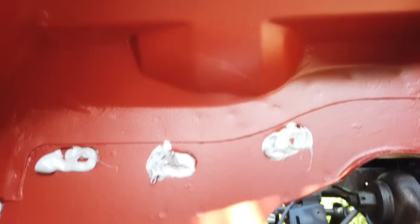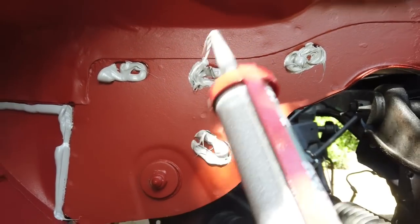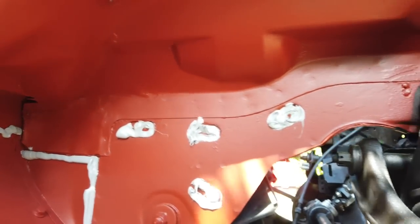Yeah, let's do these. Ford didn't do these initially, and then they did do them. These bungs here, these are for crash impact setup. Makes the chassis fold up a little easier under impact. So we'll just get our brush on that now. Remove that bolt there and we're good to go.